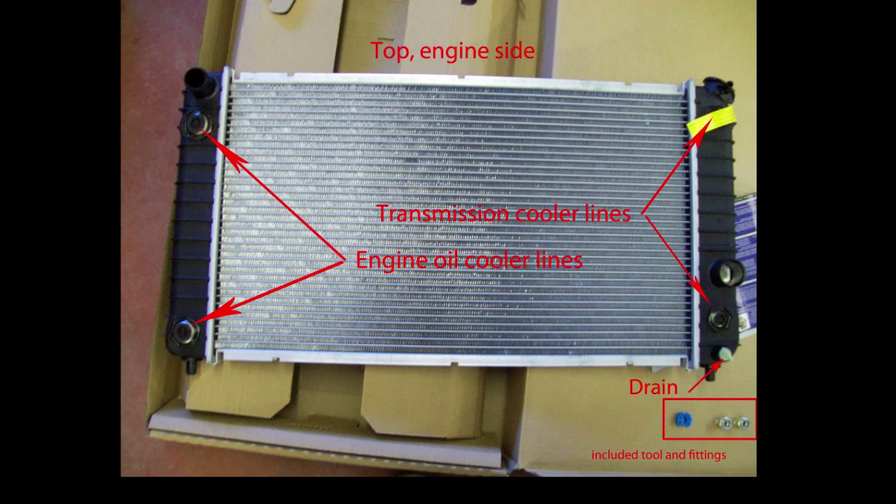One way to remove oil or transmission fluid from antifreeze is to pour your contaminated antifreeze into a gallon jug, filling it all the way to the top. Wait a few minutes and the oil will rise to the very top of the jug, and you can either siphon it off or add a little distilled water to let it overflow and eliminate the oil. You can also use a paint filter to filter your antifreeze before you put it back in.